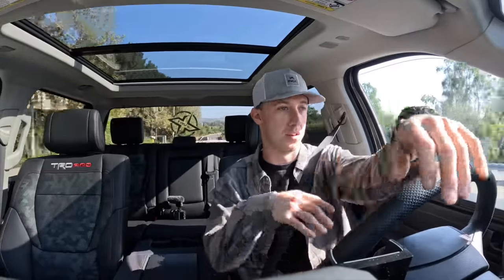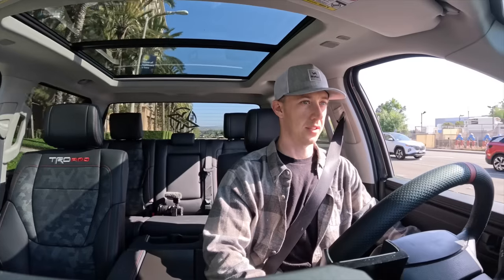It's especially rowdy on the TRD Pro because of the TRD axle back system on the TRD Pros that come standard. You guys can do that too. It removes the resonator on the backside of the exhaust where the flanges meet. From that point on back, what I replaced, up to the flange, from the flange on back is the axle back from the TRD axle back. So the TRD Pro comes with the resonator deleted pipe. So it's a little bit rowdier, that is for sure. But man, I love it. Let's roll the back window down here, get to the full experience.